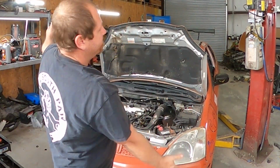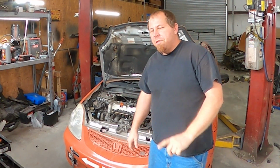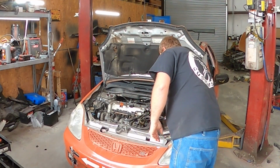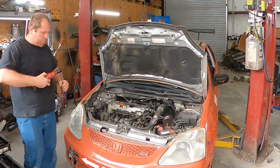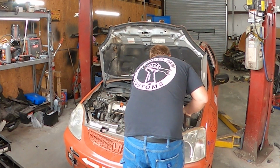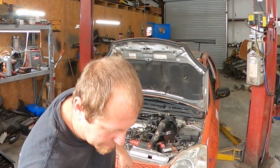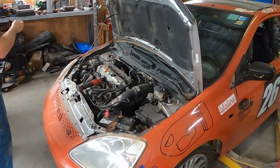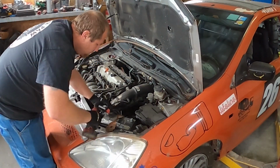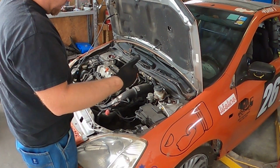So, like I said, hood's open. It's gonna go up in the air. Step 1. Disconnect the battery. I'm gonna move you guys. You guys probably don't want to stare at my butt this entire time. Okay, battery's disconnected and out.